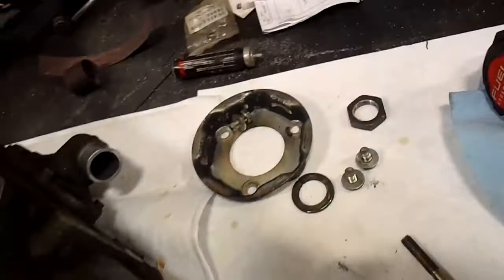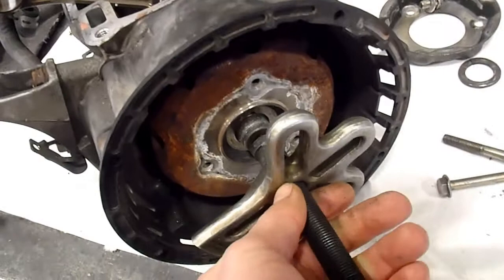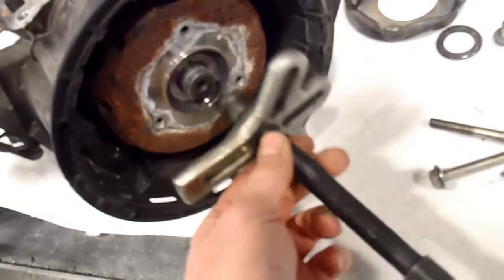Now what I'm going to do is just take this basic puller - a harmonic balancer puller that I've had for years. I'm going to be putting that on and pulling off the flywheel now. I've got to get the stator out of there and I want to get this case split. I'm behind schedule - I didn't get anything done on the weekend. So I'll get that puller on there and we'll get the flywheel off right now.